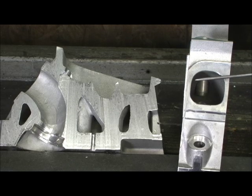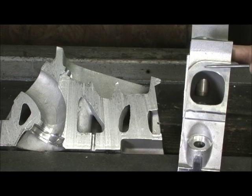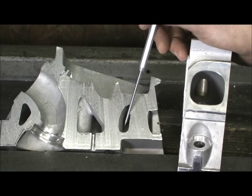You're not going to have to work on this exhaust port very hard to get it to perform. And for those wanting to raise it up, like I said, we're going to have about 125 right here where we can come on up. Width's already there. So it don't take a tremendous amount of work to turn this thing into a fire breather, but just right out of the box, it's right there at 200 with everything else. So plus here, and real big plus right here where they got that water jacket.